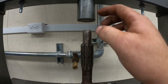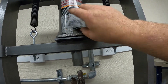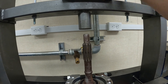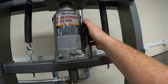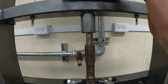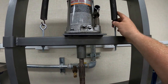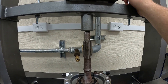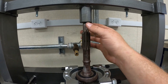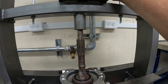At this point we're centered up, so we want to make sure that our input shaft is as centered as possible with the application ram. I'm going to turn the hydraulic release off - going all the way to the right to close that off. These hydraulic presses are fairly forgiving - they're nice for suspension bushings and things like that since they can go at a little bit of an angle. But if something is really stubborn you don't want to go too far off angle or you can damage your part or the tool, so we want to be as centered as possible.